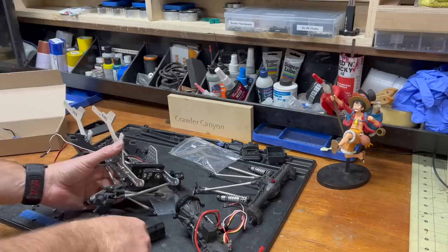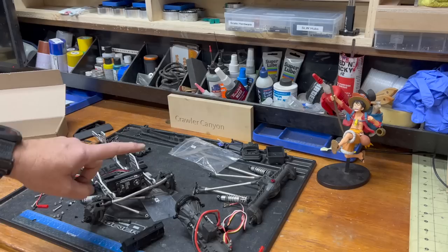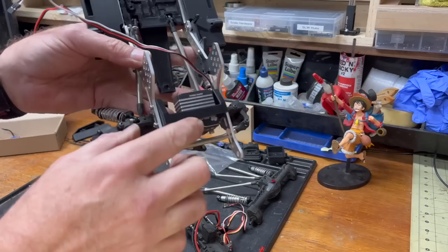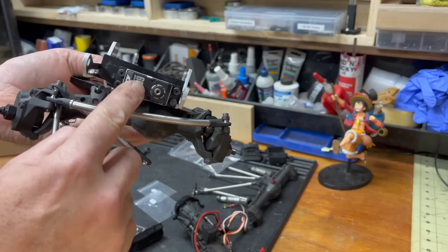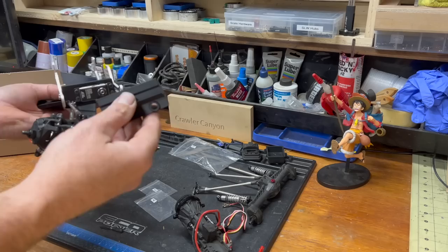I don't recommend that. I recommend against that. What you want to do is install your servo into the bracket first, then mount it to the frame, because this being a big, chunky AGFRC direct power, it was like trying to fit a puzzle piece to get that servo into the little groove. It's really quite tight in there. It fits very nicely, but trying to shoehorn it in while it was already in the frame, forget it. It's never going to happen.